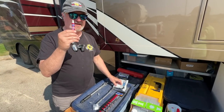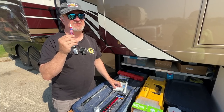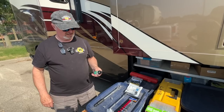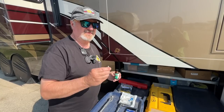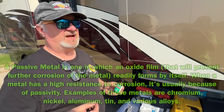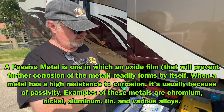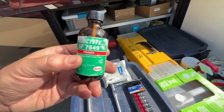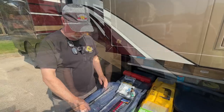To use Loctite — and a lot of people watching this are thinking they can do it with just Loctite alone — I'm telling you, this doesn't do it. Everybody finds that out eventually. I did it right because not only did I buy a cleaner to clean the threads before I used the Loctite and the Nord lock, I also discovered that because it's cast aluminum — a very passive metal — there's some fancy chemistry going on with Loctite. So I bought this SF-7649 primer to accelerate the Loctite. That was what I did because I didn't have the bars.